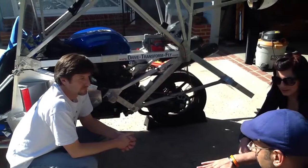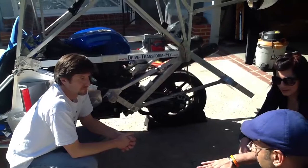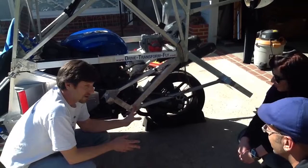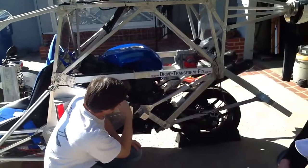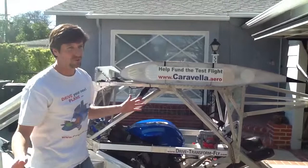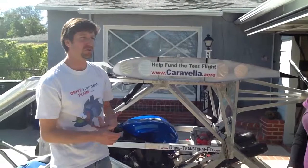So you'd have the back wheel land first and then the front wheel goes down. The vehicle has disc brakes on all three wheels — hydraulic in the front and a combination of mechanical and hydraulic in the back. The stopping on landing will all be done with the brakes. The wing has ailerons for roll control. There are no flaps, which are a high-lift device to increase lift coefficient and decrease flight speed.